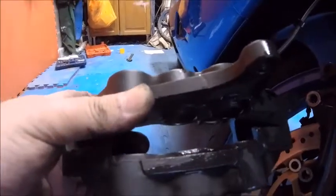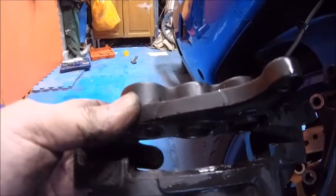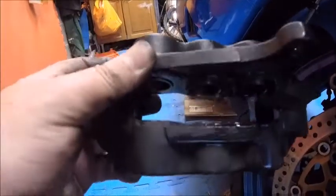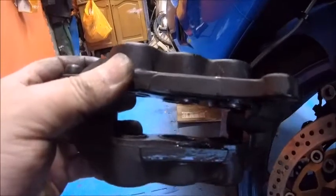I'm going to introduce fluid back into the system and use the brake lever to pump the pistons out and work them back and forth until I'm happy with them. If not, it will get taken off and stripped down. Fluid is introduced — another bit of suction and you can see all the air bubbles coming out. Just keeping an eye on the top to make sure it's okay — that looks good.